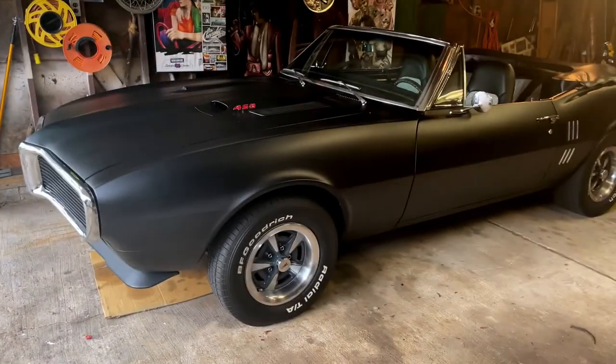It's been a couple of days. I painted the one wheel and was really happy with how it turned out - I think it's going to look awesome on the car. I took the tires off the wheels and made a separate video for that. Now I'm getting the wheels ready to go to the tire shop. First I need to clean them up and get them painted. I've got some 400 grit waterproof sandpaper for wet sanding, looking for any high spots or burrs on the finished parts. I also bought some polishing compound and polishing discs for my Dremel to go over the shiny parts.